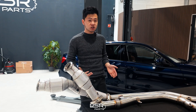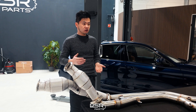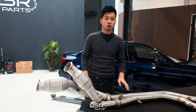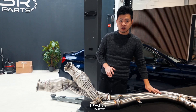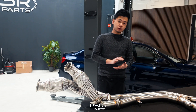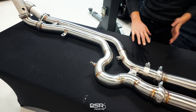Long story short, we changed the design from BMW — and you might ask why, since BMW obviously thought about this. It also had to do with packaging reasons. Since we do not have secondary cats on this exhaust pipe, we could ditch the split and go for a double pipe like this, just like it was on the X4 M, X3 M pre-LCIs, or the F80/F82 generation. This also makes the exhaust lighter and less complex because it has fewer bends.